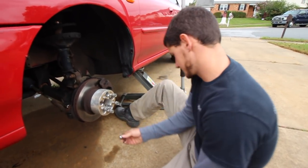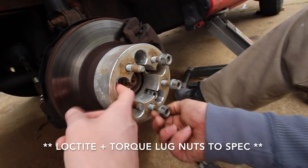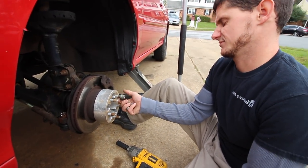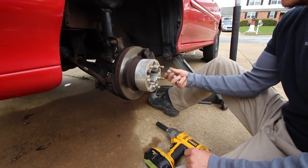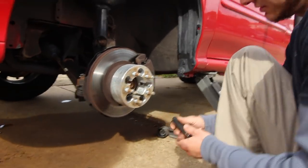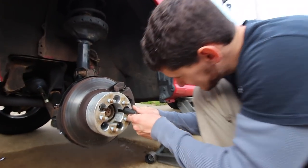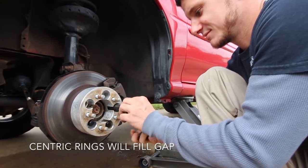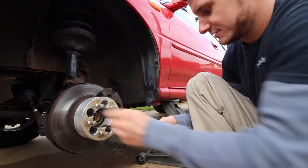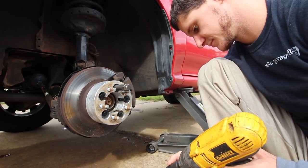Hopefully — not leaving them on there, that's for sure. It's going to be fun. If we were keeping these on longer, we would loctite the ones that go in here for sure. You just want to make sure this is not going to come loose, because the worst thing in the world that could happen is your wheel falls off when you're going down the highway. That's pretty bad. I'm just using the stock lug nuts — the ones I had on. This center hole is way bigger than my hub circumference, so definitely not leaving these on. If we were going to rock these for an extended period of time, we'd need centric rings. Or we would just not do it — if you don't mind spending money on wheel bearings every year, replacing them at least once a year. Or you could just take that money and add it into whatever budget you have for wheels and get the right ones.